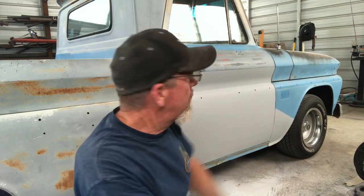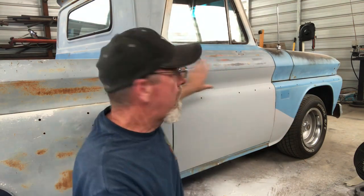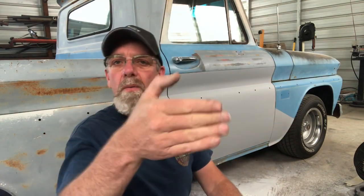It's just rookie stuff. Anyway, it's all together. The weld shrinkage from the heat kind of got a little bit of a dip going. There are different ways to try to get rid of it, but this door — this truck had been wrecked before we bought it back in '68 or whatever — so there was body filler on this door. I guess it somehow got hit over here. The farther I sanded, the more body filler I found. Not really bad, but it's still there. So the door kind of has a wave to it.